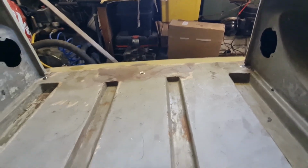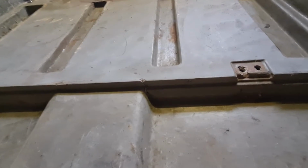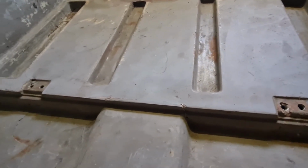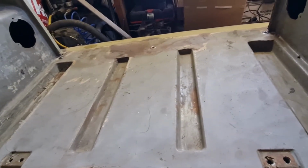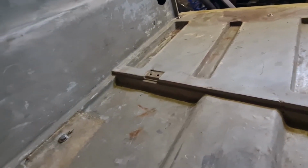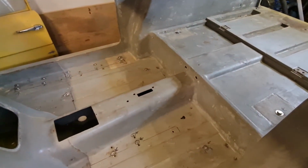And obviously once I put the hinges in there, originally they were riveted. So I'm going to nut and bolt them, so it's going to be a lot stronger with nuts and bolts as well. There's going to be another 4 fixings going through there, and by the look of the size of the holes on them, they're M8s. So those little M6s at the back won't have too much pressure on them, hopefully. So that is super duper. The body and chassis are now one again, hopefully for the last time. I don't want to be taking this apart again.